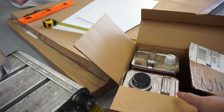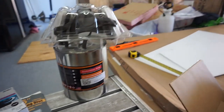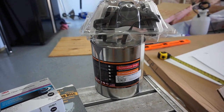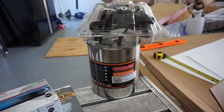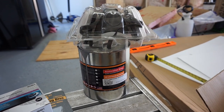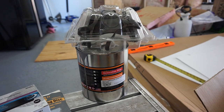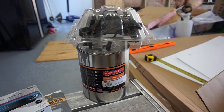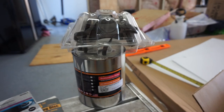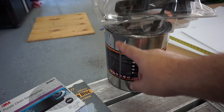You get your hardener for the clear coat and your reducer for the paint. The color we went with is Dove Gray — it's an off-the-shelf gray color, like what I call a battleship gray, something I've always liked. It goes really nicely with the black accents, which is what we wanted. Basically you get everything you need to spray through the gun. Total price shipped was $320. If you live in California it's a little more expensive due to VOC restrictions — that requires a special mix. We're in Texas so we don't have that issue.